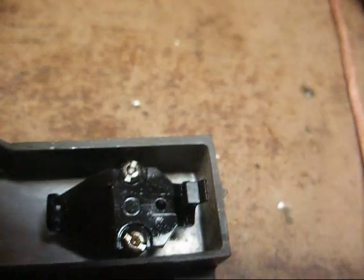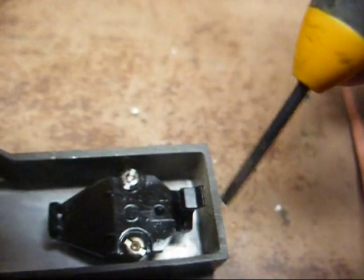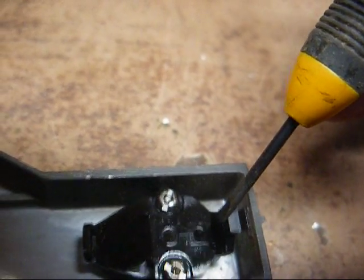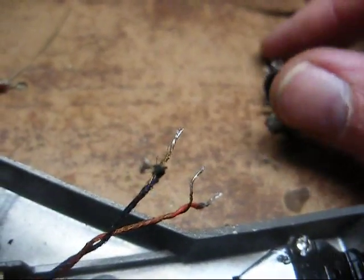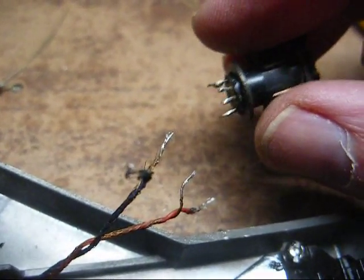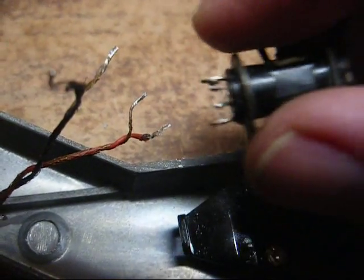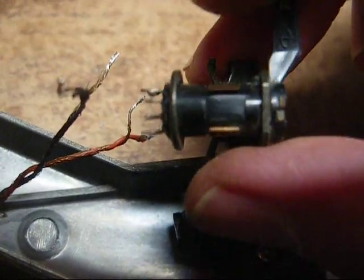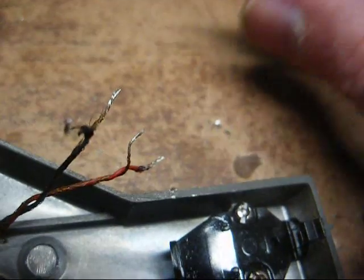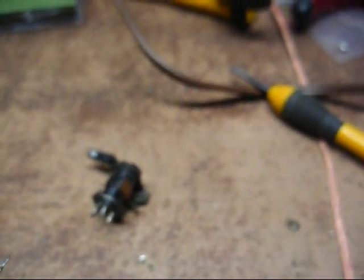Here's our new mounting bracket installed. You want to make sure the bracket is installed straight, the screws are securely tight, and that you have the bracket situated the right way — the little clip part goes towards the front of the tone arm, and the part with the little hole goes towards the back. We have our holder unsoldered; generally all you have to do is touch the terminals with a hot soldering iron and the wires will just fall off. One of the other advantages of using the upgraded cartridge is when you flip from LP to 78 you're flipping just the stylus, not the whole cartridge. On this original type, you're flipping the whole cartridge holder, which can stress the wire leads and cause them to break off from the terminals — I've fixed numbers of these school record players with that exact problem.